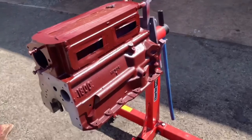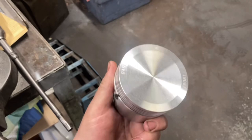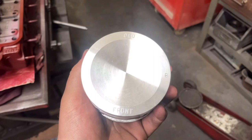We've just had a set of pistons turn up for the MGB. Fairly nice pistons, all new. I've gone to try and put them down the bore — it says plus 40 on the piston — and they're more than tight, they won't go in. So we realise these are the wrong ones. The bore's only been bored out to plus 20, so we're going to have to get a new set.